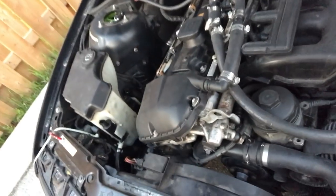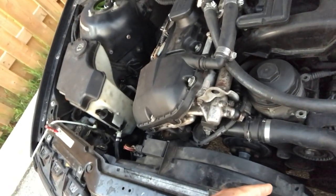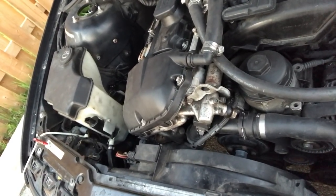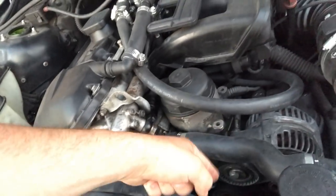Right down there is a power steering pump. It's not hooked up to anything. There's no lines or anything. So I was just using it as a pulley because I couldn't get a belt that would fit with the power steering delete from Condor Speed Shop. So what I ended up doing was just running it as a pulley, and I roasted the power steering pump and it almost caught on fire. So yeah, we're getting towed.